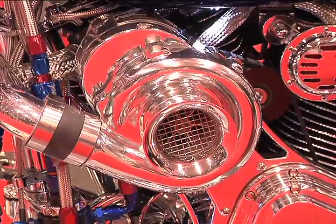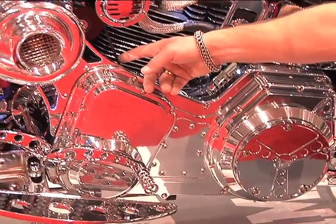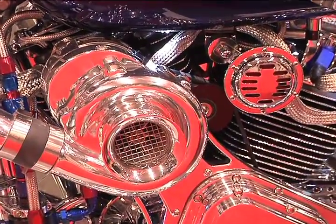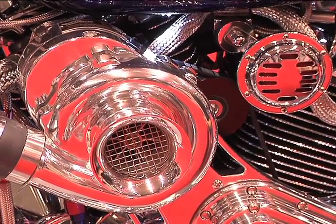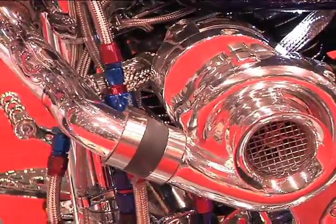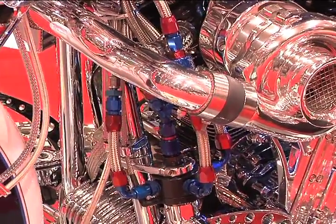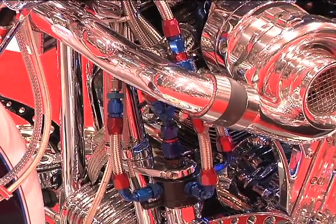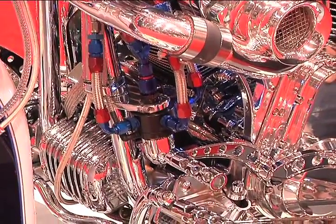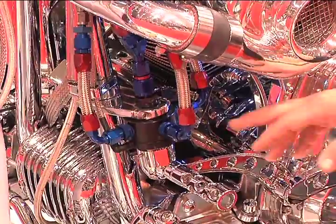The Pro Charger uses a Gates wet belt inside. There's a modified cog and a Gates wet belt that goes all the way around, transferring to the outer belt which transfers to the transmission. On this particular build, we put a 2.55 pulley on there to make the impeller spin a little bit faster, with a more aggressive impeller that they changed. Over here is a pressure release valve — when you're under normal driving conditions the blower is always on, but the pressure relief valve lets air bypass out when you release the throttle so it doesn't collect in the manifold.